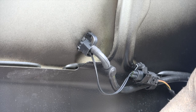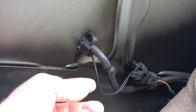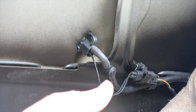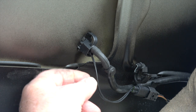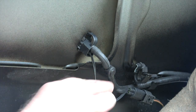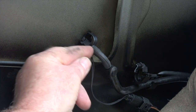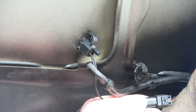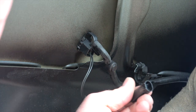Here is a close up of the underside where the washer jet fits through. This one is heated — I'm not sure whether they are on all Range Rover Sports or Range Rovers. You have got the heater connection here which simply unclips. You have also got the one-way valve here, and you can either undo the water hose on this side or there — I simply just pull it off here. Then you just undo the electrical connection by lifting the tab and pulling. It comes off quite simply.